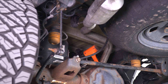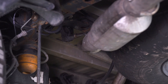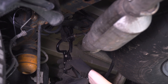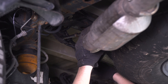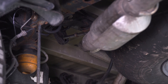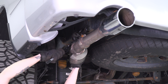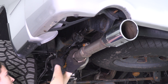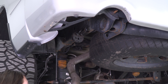You can do this by hand, but if you need, you can also use a rubber mallet and lightly tap the top of the exhaust pipe here to release it. Once we've loosened up that pipe from the muffler section, we're gonna remove these hangers — there are two on this side. We did use a little bit of PB Blaster to help speed up the process. Now we're gonna remove the backmost clamp on the other side, similar position. Once that is out, we can wiggle the pipe out the rest of the way and remove it off the truck.